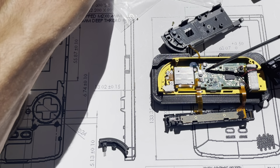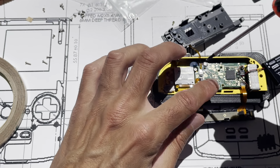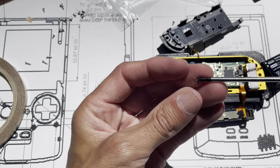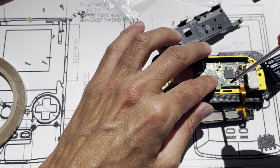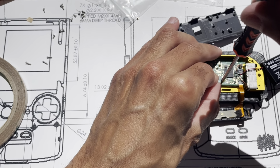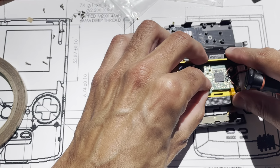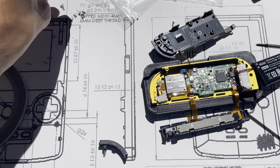I think you could probably do three millimeters. You'd have to feel it once it goes in. It's not gonna be a bad thing necessarily if you start it. It just doesn't want to go in. But again, if you're feeling resistance and you're not bottomed out, meaning the fastener hasn't captured whatever piece you're fastening, and if this was still loose and I still had it sticking up, I'm gonna have to go with a shorter fastener.